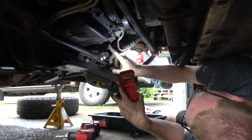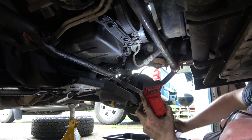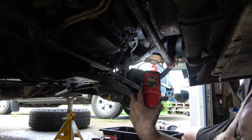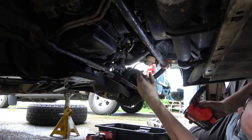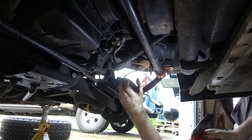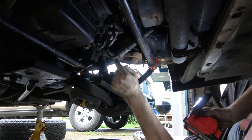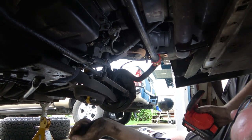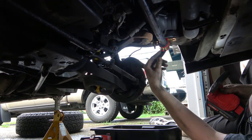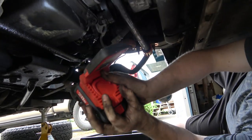I've got an oil leak right here — I think the sensor is leaking. That's not this job. So this big nut right here we need to get off, and then there's a little tool we're going to slip over it and it'll pop this off. Once that's done we can get our fittings undone, get the steering shaft taken off, and then it's just three bolts holding it on and this should come out — it's probably going to come out right about here. Hopefully I don't have to take the sway bar off.